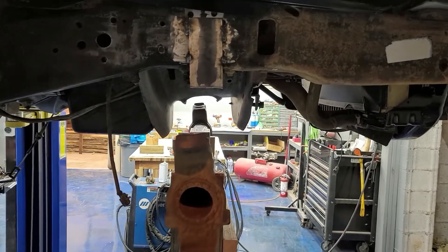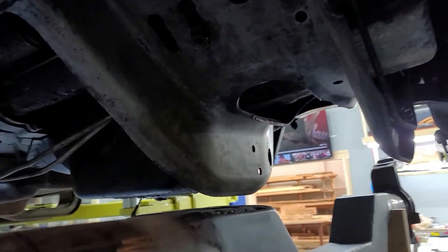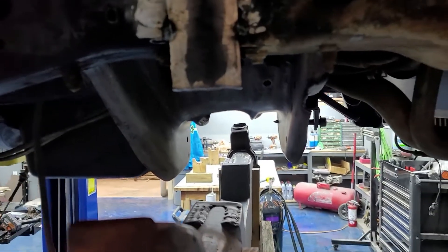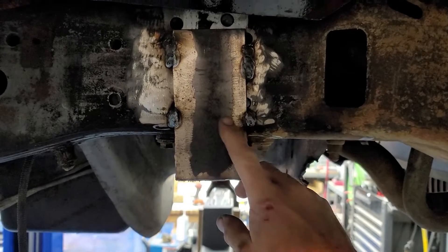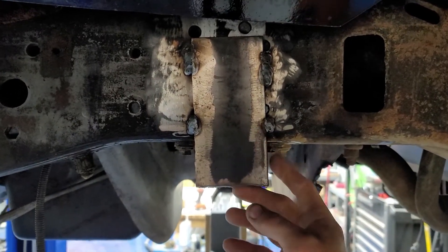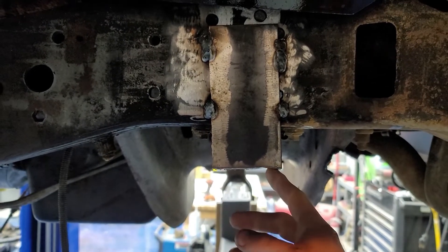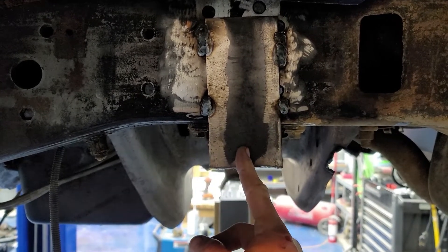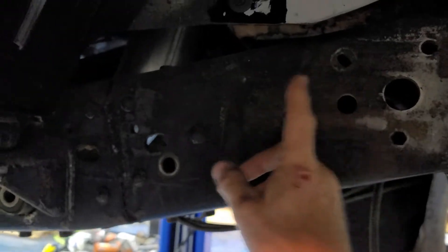Here and there in the last couple weeks I've been chipping away at some of the old dirt and crud that was on that crossbar under there - you can see it's nice and clean now. Next step I'm gonna cut this piece of plate off of here, then take the bump stop off from behind it. Basically the center of the bump stop is going to be where the center of our axle location will be, so once we get that bump stop off we'll mark that.